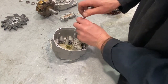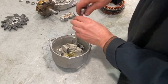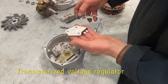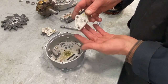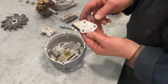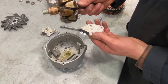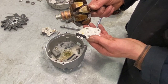Just taking out the voltage regulator right now and the brush assembly. Chevrolet used to stack their brush assembly right on top of their voltage regulator. This style of alternator used a transistorized voltage regulator. In the old days we used to have external voltage regulators — this one is obviously internal, inside the alternator. These are nice and compact, fully solid state with no moving parts, fully transistorized. Their sole function is to monitor the amount of voltage in the battery, then adjust the strength of the magnetic field on the rotor to raise or lower the voltage output going to the battery.